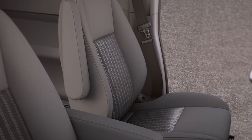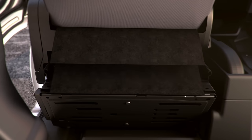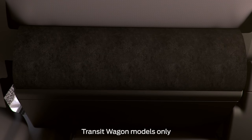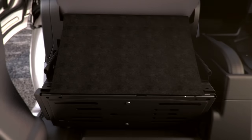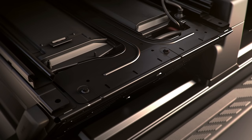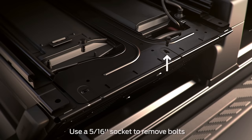With the armrest folded up, slide the seat all the way forward. To access the battery compartment on Transit and wagon models, first remove the protective plastic molding by pulling up on the tabs and sliding it towards you. Next, lift the fabric cover trim by pulling up on the tabs and tuck or fold it to keep it out of your way.